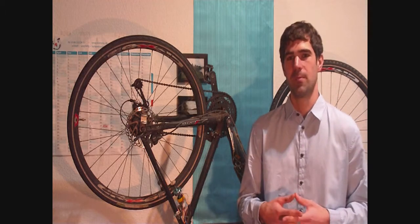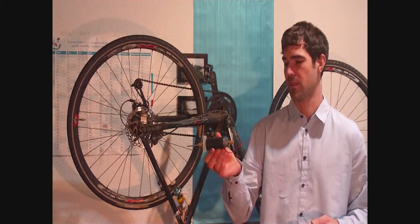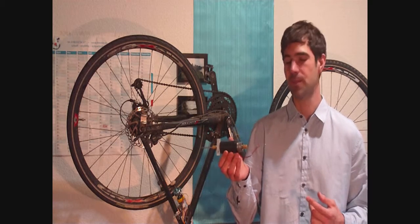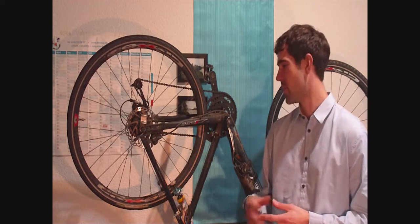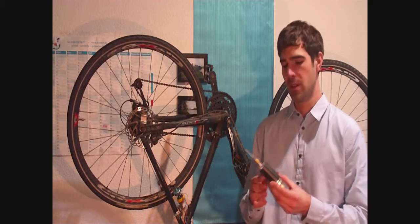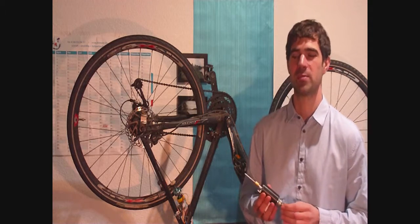I got a small bell-type motor and already mounted it to my bike, but it came with a kV rating of 850, which is much too high. For comparison, if I translate the DC motor I tried first into kV, it spins at 280 kV — much smaller than 850. So I knew right from the beginning I would have to rewind the motor I bought, and figure out how many windings I would need on each pole. I found the data sheet online, which tells how much RPM you get at a specific voltage.